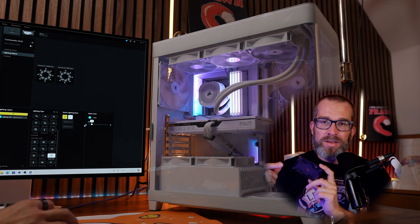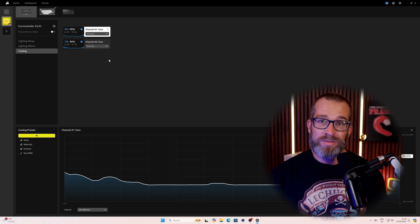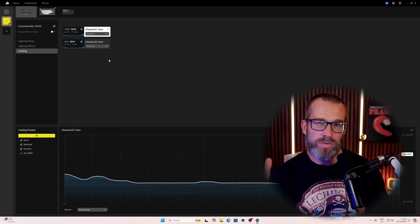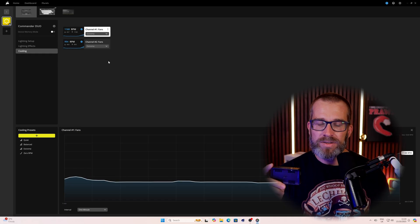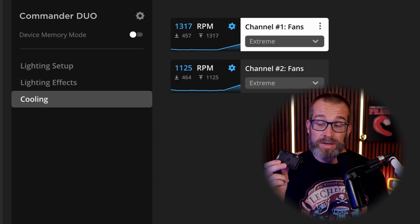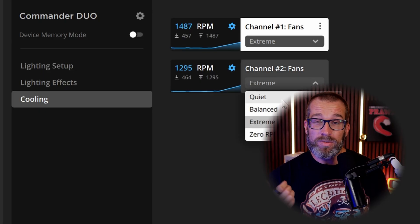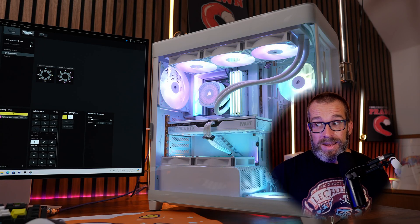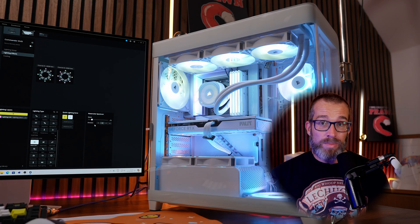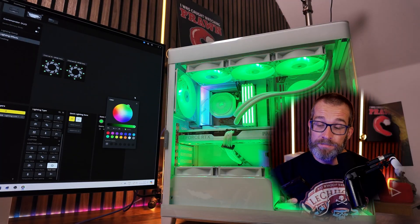Because the fans are chained together, all six fans in that chain will have the same RGB lighting and the same fan speed, so you can't have individual control over each fan. But it does mean you can use it with Corsair's ecosystem — so if you already have Corsair RAM in your system, you can get that all in one place, match up the RGB lighting, and control it logically from one piece of software.